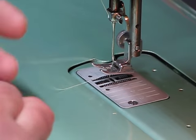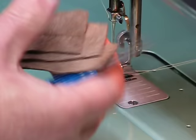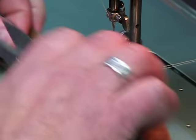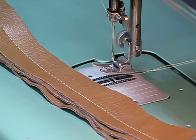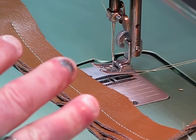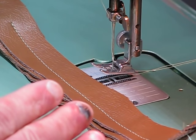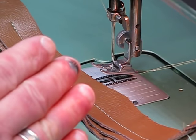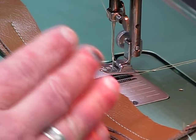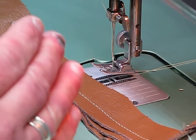And what we just sewed through is no small task, not even for a Husqvarna Viking Type 21 with a 1.5 amp motor. We just went through three layers of genuine cowhide. I actually put a lighter needle in this machine, expecting to use it for some of the embroidery type patterns that are part of the cam system. You may have noticed right at the launch, as it was beginning to pierce through these three layers of genuine cowhide leather, that needle started to bend a little bit, and I said to myself, in my head, uh-oh, I should have gone with a heavier needle, but we managed to get through it somehow. It's really quite a miracle.